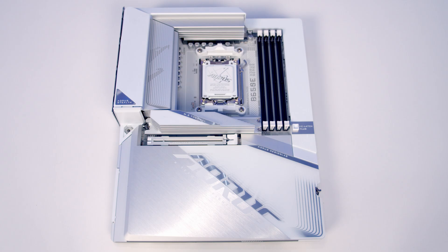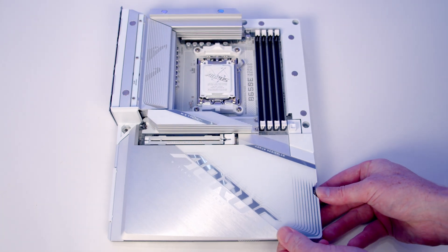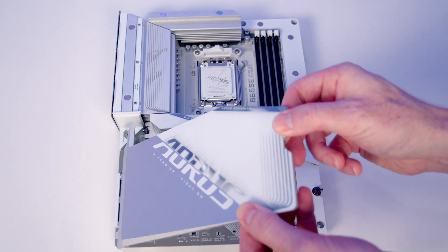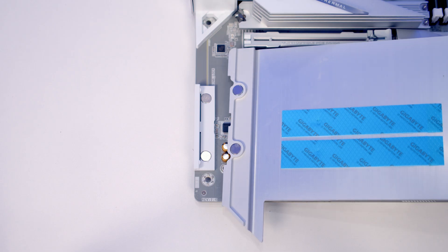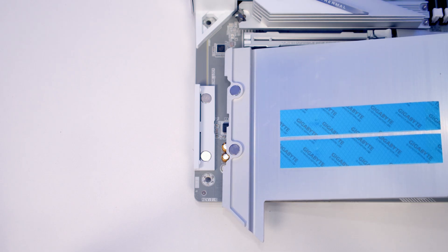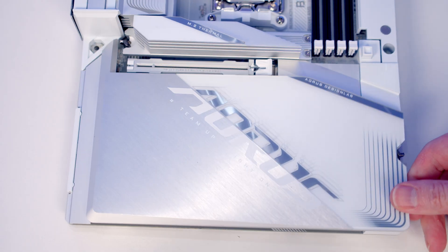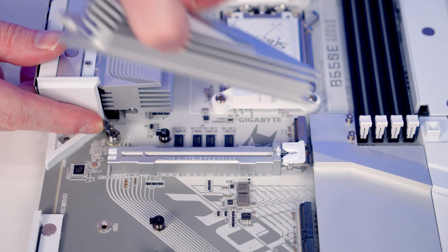One of the reasons the motherboard looks so clean at the front is that you can't see any of the screw holes — they're hidden by two magnetically attached panels on the top of the motherboard as well as the large lower heatsink. To remove the lower heatsink there's a little clip on the right-hand side; push it down and lift the heatsink up and away. You'll notice there are magnets on the back of the heatsink and on the motherboard itself, designed to help line the heatsink up when reinserting it. The large beefy heatsink over the top M.2 slot is removed in exactly the same way.